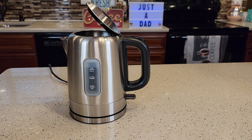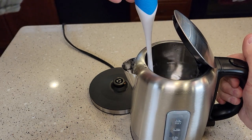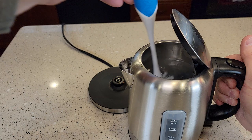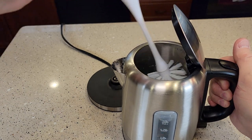You don't have to heat it up — we are going to heat it up later for the cleaning process, but not now. After about an hour, mine wasn't really bad, but it does help if you get a soft bristle brush and go down in there. It'll help break loose some of that hard water deposits and clean your screen. This is a great time to do that.